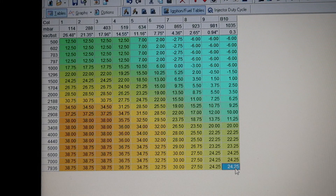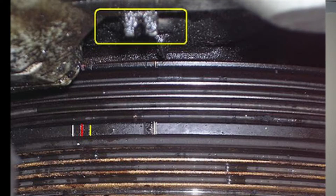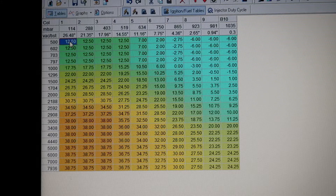Instead of 28, it's now like 24 degrees up top. None of this is important unless you actually get your mechanical timing synced up to this 12 degrees. For the OBD2, there are three notches on the crankshaft pulley — 10, 12, and 14 degrees — and the center notch is 12 degrees. On an OBD1, it's 14, 16, and 18, with the middle notch being 16. There's always that one notch far off to the side — that's your top dead center.